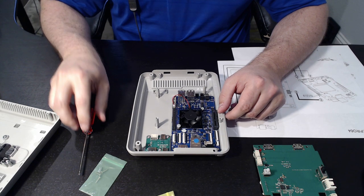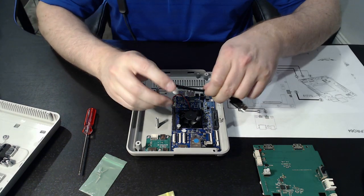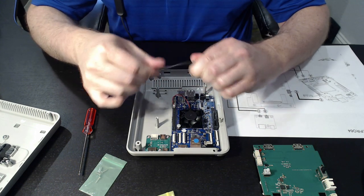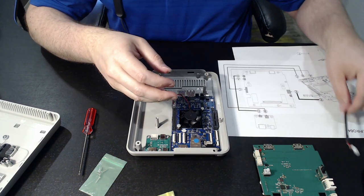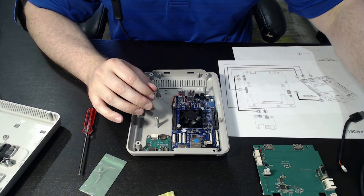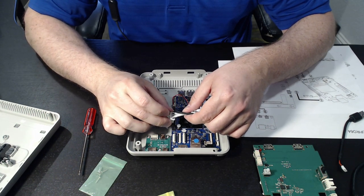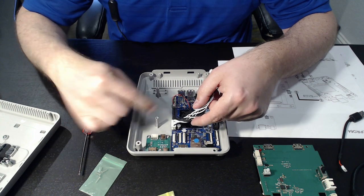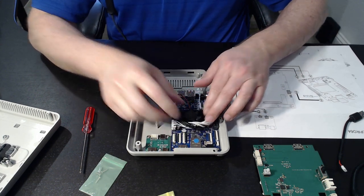We're back after a little bit of technical difficulties regarding the cabling. One of the things I'd strongly suggest is to remember that these cables are pretty stiff. Give them a little bit of flex because they'll be stiff just from fabrication. It's going to feel as if some cables may be too tight; however, as long as you're careful and pay attention to what you're doing, you'll be fine. Per the diagram, we're going to connect with the white wires on this wiring harness to the very beginning of the GPIO header closest to the HDMI port.